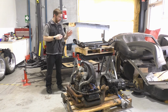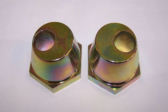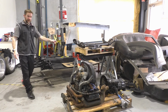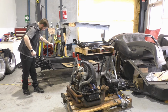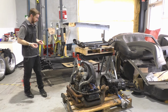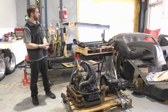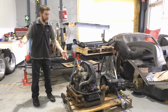We got the front brakes sprayed and they're ready to be whacked on once I get those little, what do they call, the camber adjustment nuts or something like that. They go onto the end of, or top of, the actual ball joint here. And yeah, before I go, my plan, from reading someone's comment online, is that this will be flipped. Then I'm going to cut open the bottom section there, much like I did on the A-arm to remove that bolt. So I'll be slicing this open enough to be able to remove the existing nut, weld a new nut in. That's just getting worse. I'm getting out of here very soon. This is just picking up crazy. I'll be cutting that open, welding in a new nut, and then of course, hopefully, job done there.